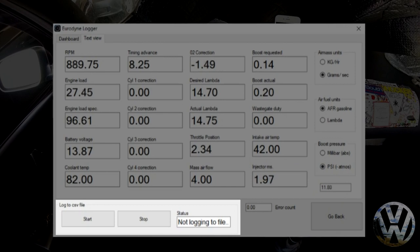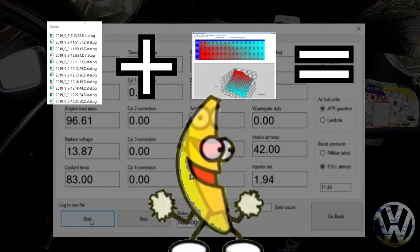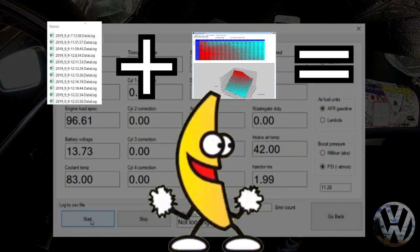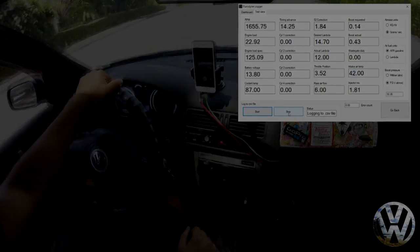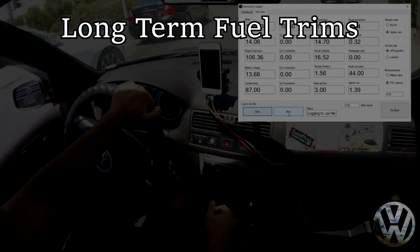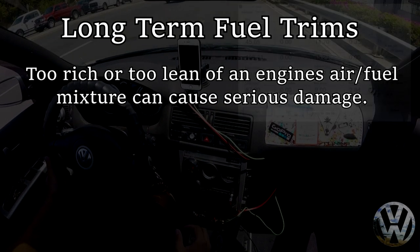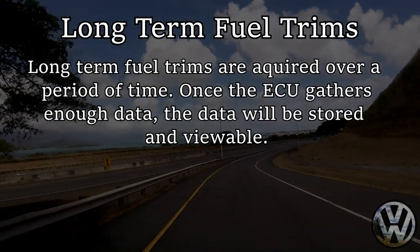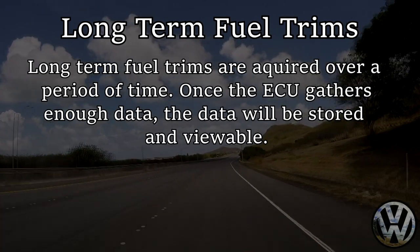Down in the bottom left corner there are two buttons to start and stop data logging. Once you hit start, a file is created live until you press stop. The file is automatically saved to your computer and can be opened in Microsoft Excel for detailed review. You can also use these saved logs to tune your custom Maestro file — overall a great feature. Now that the logger is set up and the car is ready, begin phase one by driving normally. One of the biggest impacts on performance is your fuel trims — if they stray too far from the usual tolerance, it will trigger fault codes and can cause engine damage.